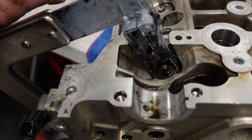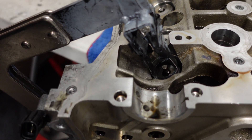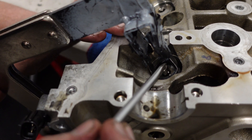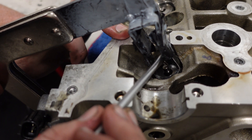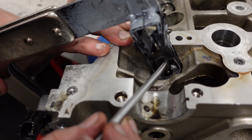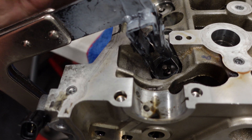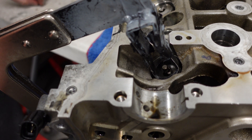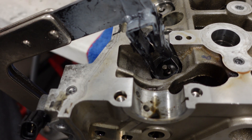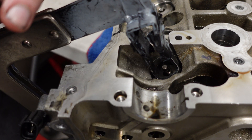We've got to put them back in - it's a bit difficult with the camera in the way, but I'll do my best. Actually it's quite difficult anyway. I've found you get a bit of clearance on the top side by moving the top wedge in first, because for some reason this spring compressor doesn't want to sit center. It works well - you can clamp the top one in like that and then just drop the lower one in.